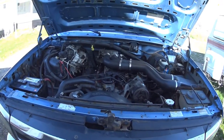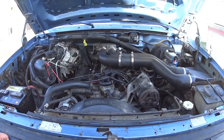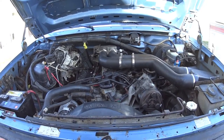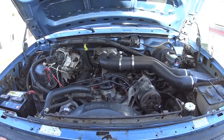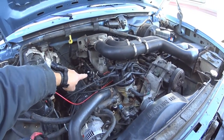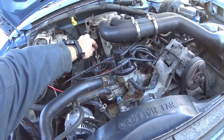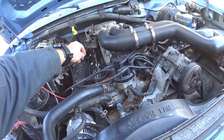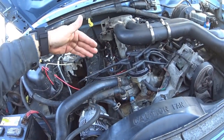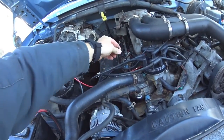There she is purring. I still have a miss, so I know the injectors are not the issue — I need to be looking at my spark plug wires, which may be old. Just because spark plug wires look nice on the outside doesn't mean they're good; there might be a break or something going on. That idle is a little bit rough, which could be the idle air control valve right underneath here — I can look at that later. Also, whenever you mess around with fuel rails there is a rubber o-ring gasket down inside, and screwing around with opening and closing it can sometimes dislodge it or cause something brittle to break. So you've got to be careful on older engines. I always start the engine and run it without the cap first to see if there are any leaks — it's bone dry, so make sure at that point you put the cap back on.